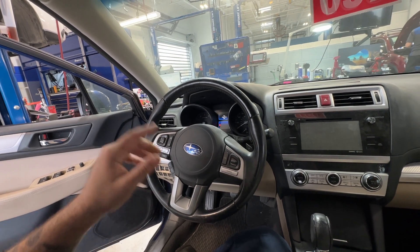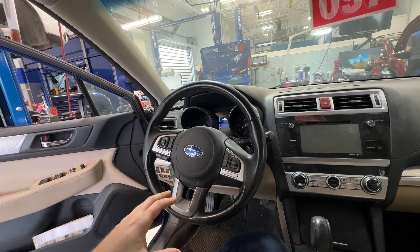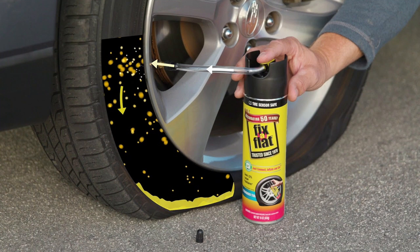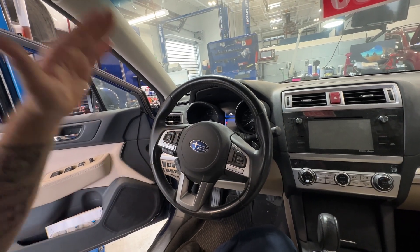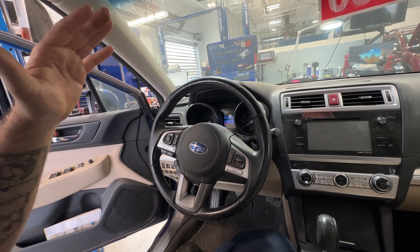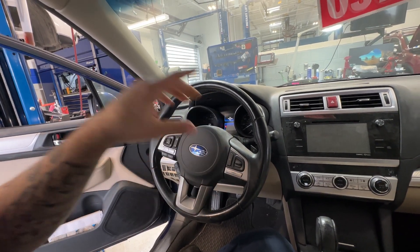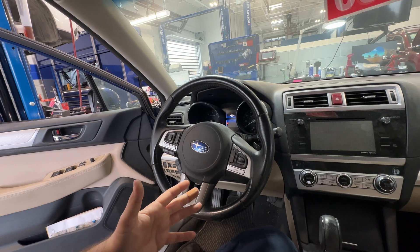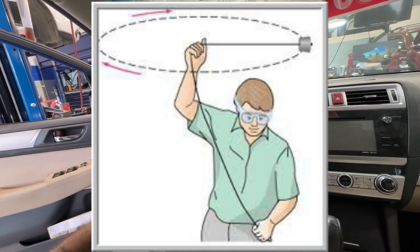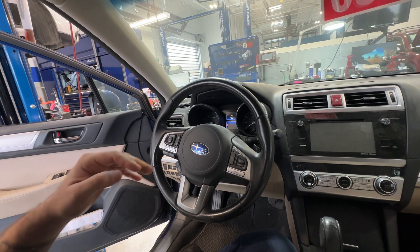There was one spot on the graph where vibrations went up while decelerating in speed — I see that when there's water or Fix-a-Flat in the tires. What happens is when the tire spins super fast, all that water goes to one side and causes a vibration. As you slow down, centrifugal force decreases and the water is allowed to slow down, causing a harsh vibration temporarily until it evens out in speed with the tire. You could try it yourself with a ball on a string — spin it fast, then stop it and watch the tension change.